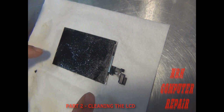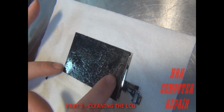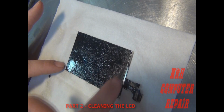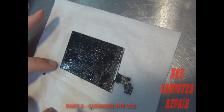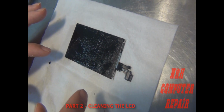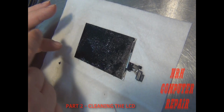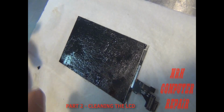So you've got the light box removed. You're working on the LCD LOCA glue, and once you get that cleaned up, then the next step is to refurbish by using LOCA glue, putting on new glass, and putting it under UV light and all that stuff, and we'll get to that one in the next video.